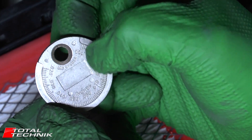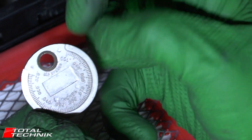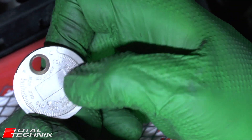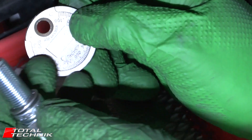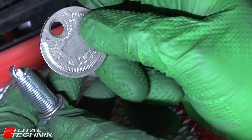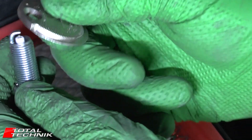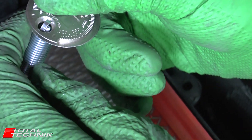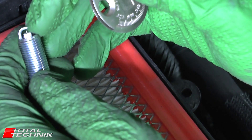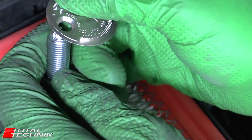On the front here there's a hole at the top and just underneath it says 'gap opener.' You use that if your gap is too small — if you measure it and your gap isn't wide enough, you can use that as a leverage tool. Just place it in there and lift slightly to bend that arm just a tiny fraction if it's required.